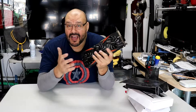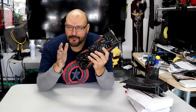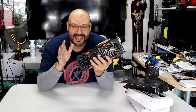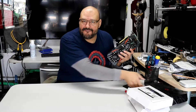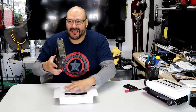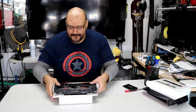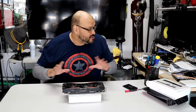If you're gonna mess with this video card you might void the warranty, so be careful — it's very delicate. Before you start, make sure you have a static-free environment. Avoid plastic as it creates a lot of static. Place the video card on cardboard so it's not touching plastic, and make sure you touch some sort of metal to discharge yourself.